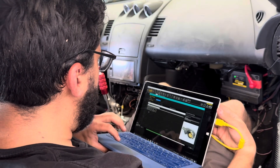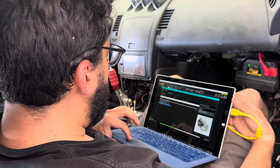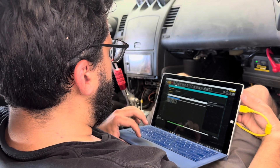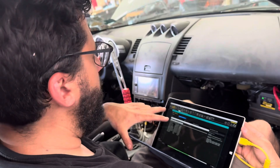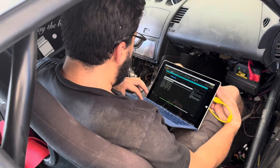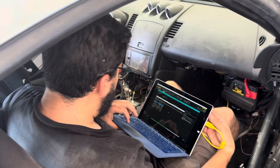Now it's asking for drive-by-wire: GM drive-by-wire 87 millimeter — I have a 90 millimeter but we'll do 87, I don't remember the exact size. Next. The on/off switch is already blinking red — it wants you to reset, but you don't have to, you wait until the wizard's over. Now it wants to know the MAP sensor, which is a stock LS3 Gen 4 one-bar, not a three-bar.